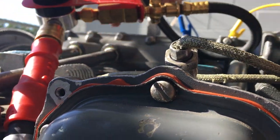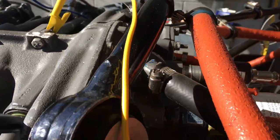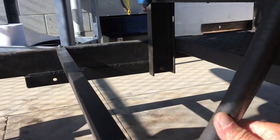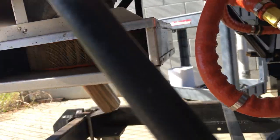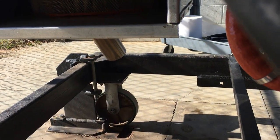The other place the sound can come from is the breather — the crankcase breather. If it's coming past the rings, then it's going to be coming from the crankcase breather, which is this hose on this engine down here. Hear that? You can hear it — you can probably feel a little bit of it. So what we have is a leak that's in the cylinder past the rings.